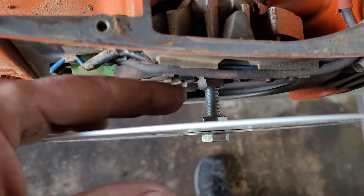So many people don't use their brains. They think you have to have something made very professionally and nice, and stuff like that can be nice. If you're doing this all the time, by all means do it. But there's a lot of ways to make something good very simple. I see a lot of people using the chuck on a drill bit — that's fine and dandy, but whenever you're using that, if you tightened it up at all, you would stand the chance of possibly marring your threads on your crankshaft. I don't want to do that, plus it would be pretty hard to get back there and tighten it up.